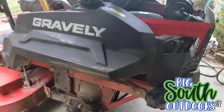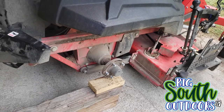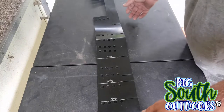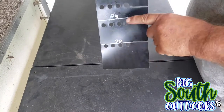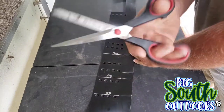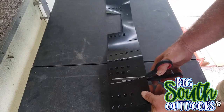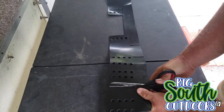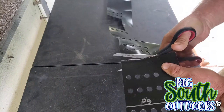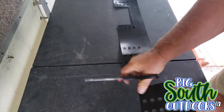As you can see I've got the tires off. I know I don't have jack stands, but the way this machine is built, jack stands would be more of a hindrance than a help. I had some wooden blocks and they're pretty good and solid — they're not going anywhere. The next step in this process is to find your size deck on the rubber. There's 66, 60, and 52. This is a 452, which means it's a 400 series with a 52-inch deck. I've got my scissors and we slowly and methodically cut the 52-inch line, being careful to stay as much on the line as possible. That's some thick rubber — it sounds like it's fiber reinforced.